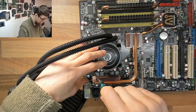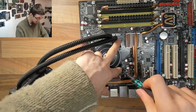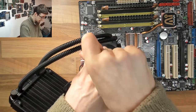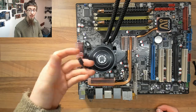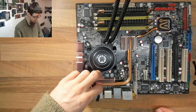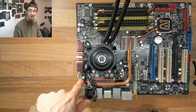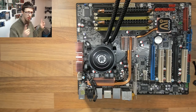Tighten everything down to the stops. You don't need to crank these screws really tight — the flex in the black metal arms will provide the hold-down force for the cooler. All you have to do is turn the screws until they hit the stops. Then if your motherboard has dual CPU fan headers, connect the pump to the secondary fan connector. If you only have one CPU fan header, connect the pump to one of the chassis fan connectors. Your chassis fan connector might also be in the top left of the board. However, I'm going to remove this and fit it into my AMD build now.